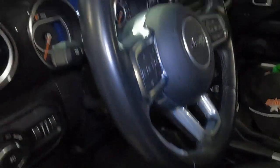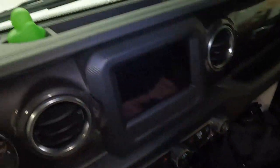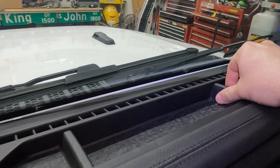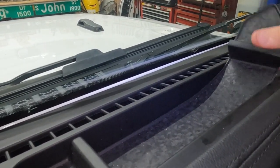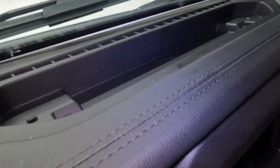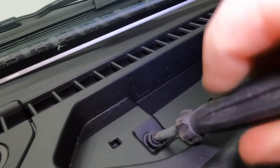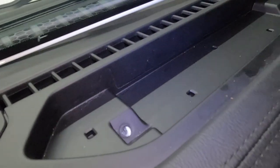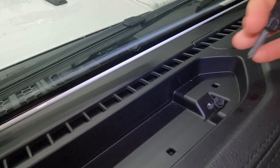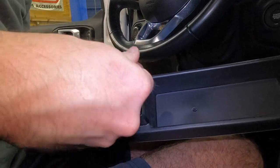So let's start on the cell phone holder. It looks like for the first thing you do for the dash mounted phone holder, you first have to remove all ducts. So I've got the ducts out of the way and we're going to be taking this rubber piece out. Then the next thing is there should be a Phillips head screw right there — take that out. There should be another one right here. So starting on putting the cell phone holder in.